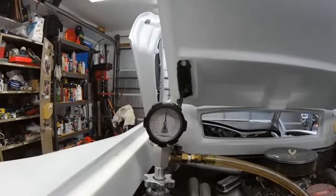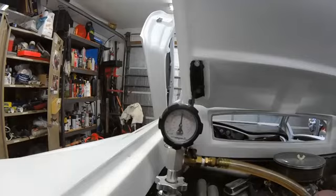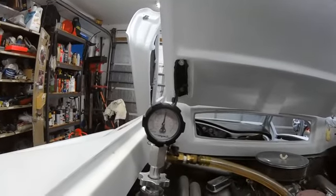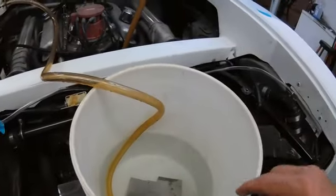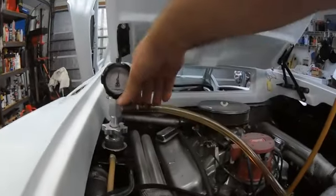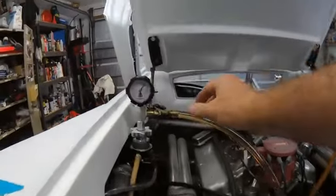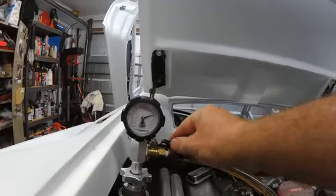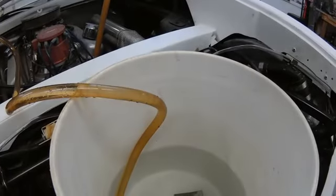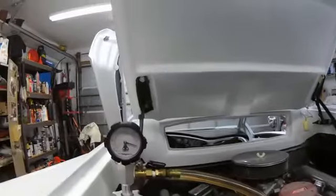Well it's been two hours and the best I could get is 15 inches. So we're going to go ahead and give it a shot - that's the best it's going to do. I've disconnected the compressed air and switched over just to the tube running into my water. Now that we've drawn a vacuum in the system, I can open it up and pull water in. There she goes - you can see the vacuum coming down as the water is going in. It's not pulling a whole lot in though - my level in the bucket only went down about an inch and a half. And I'm back at zero.